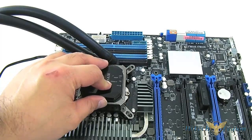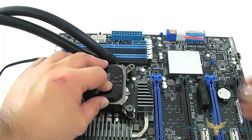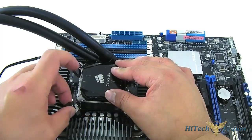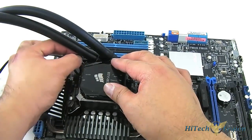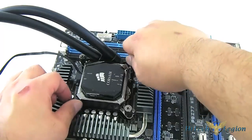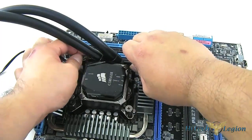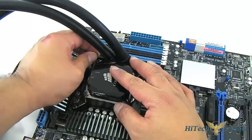You can see it's much easier to install if you've installed the H100 before — the H100 was very tight, especially when installing on LGA2011. Just put it in. As with mounting any heat sink on your system that has four screws in each corner, I advise not to completely secure one corner at a time. Do it in increments — 25% each corner — until you reach the maximum locking security. There you have it, as simple as that. You can move the hose if you need more room to maneuver, or use a screwdriver to completely secure it.